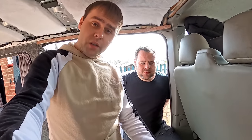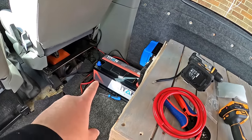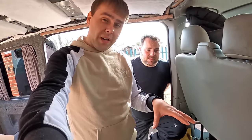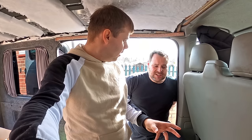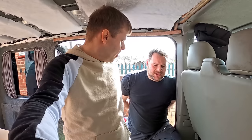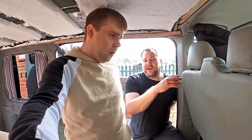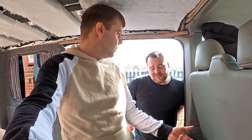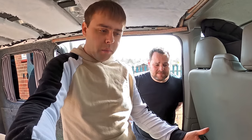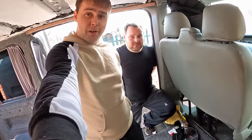I'll leave a link in the description if you want to check out Titan Batteries. I've got the flagship 150Ah. Chris also told me they do an entry level 80Ah battery, which is the equivalent of two 110Ah lead-acid batteries - because with lead acid you can't drop below 50% without damage, the 80Ah lithium is a fantastic entry point if you're on a lower budget. Shout out to Chris and Titan Batteries - I really appreciate you sending it to me.